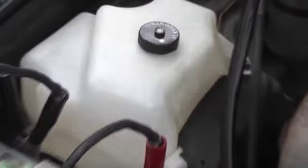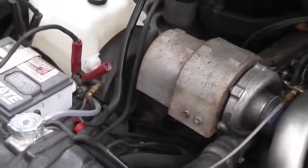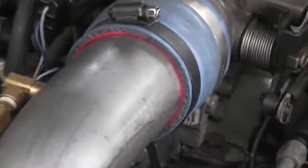It's alcohol, methanol injected. There goes the alcohol tank right there. We just topped it off, so we're good to go there. Bottom line with this is, it's 22 pounds, 22 PSI boost. It's going to scorch some alcohol in there, and if you run low on it, it's guaranteed to blow a head gasket. Hopefully that'll be the least of your problems.